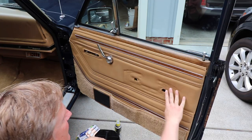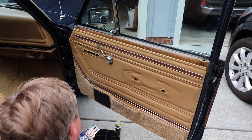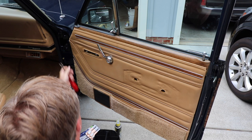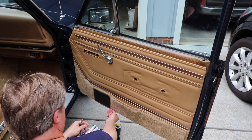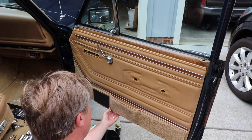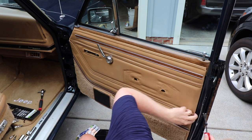I've already gone ahead and unfastened the armrest here. I've taken that out and gotten it cleaned up. I've removed the nice attractive face plate that comes off. Right now, everything is pretty much unhinged. I've got a tool here for body panels, and there are attachment points along the way. Some of them have come out, and for those I have a few screws to hold the bottom on that are hidden inside the carpet down here, which I've loosened up already. The panel's loose.